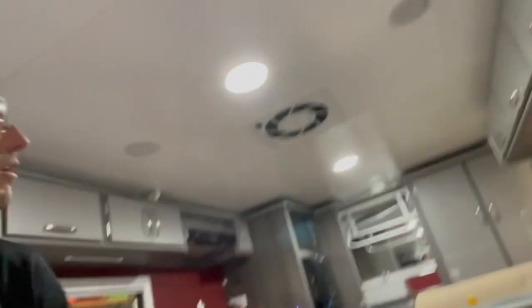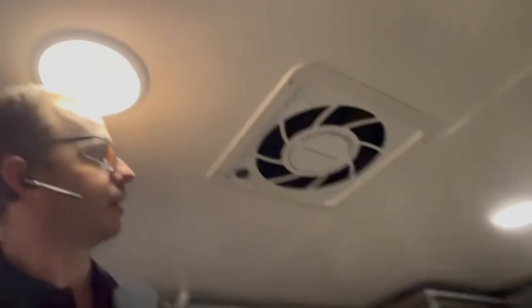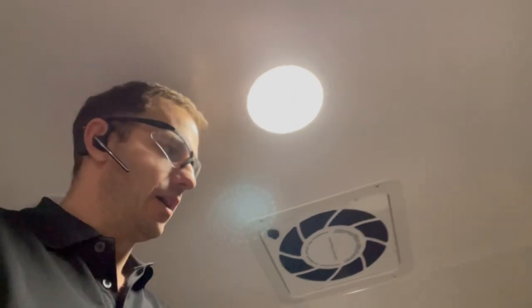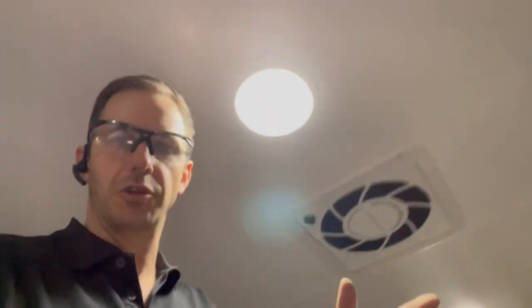This one we've done here in the position where there would be a rooftop AC, and they're not overly heavy — only a few kilos, so you can look up the specs online. We've kept this in a nice straight line as you can see. It's up on the roof here. The supports run either side of it horizontally, and the 360 cutout that would be there for the AC is there to support that. These don't really need a lot of roof support because they're so lightweight, but the idea is if you've got sandwiching — when you do your cutout, if your roof has nothing in between, you do have to pack it out with a timber frame. In this case the frame was either side of it so it wasn't required. So if you can line up your cutout right in the middle of your supports, you can actually pick up the supports with these end screws.